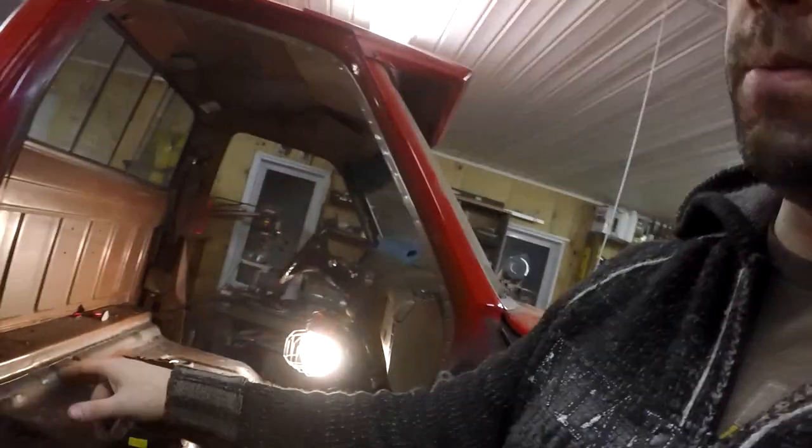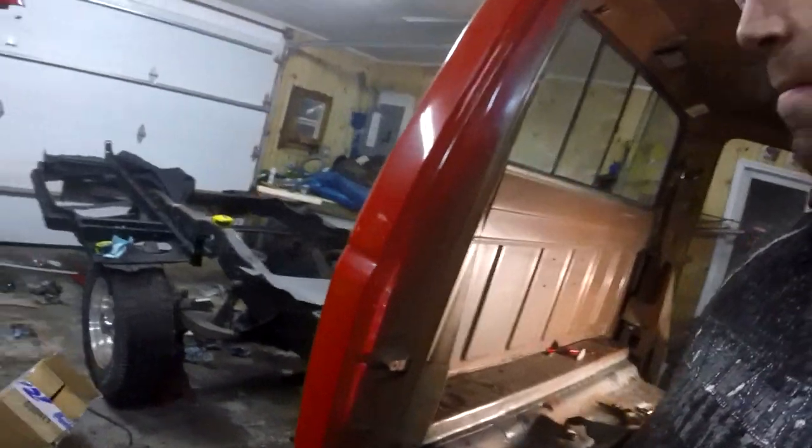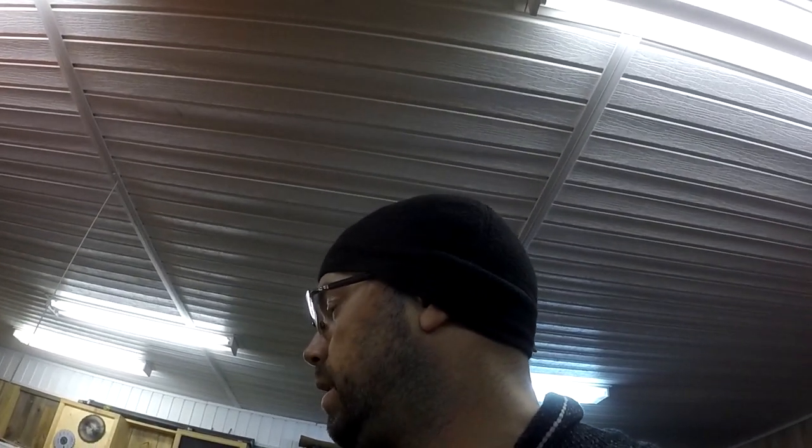Next thing - I'm going to end the episode here. We went through quite a bit. I still have the other fender so I'll probably cover the other fender and cab corners in the next video. We started with the fender as practice, then moved on to more structural things. It's not the prettiest but I might have to redo it in five or six years. I'll cover everything with welding sealer - like caulking - on both sides so no moisture gets through, then cover with rust reformer and a couple coats of paint. Next episode is tearing apart the major cab corner. Hopefully you guys enjoyed the episode - looking forward to getting the welding done, moving on to putty, putting this truck back together, doing a tune-up, and seeing if the engine runs.